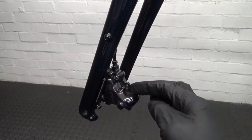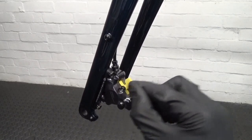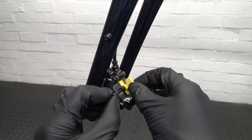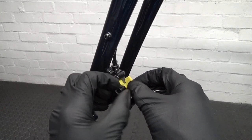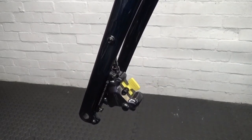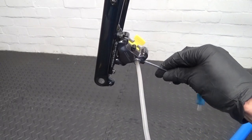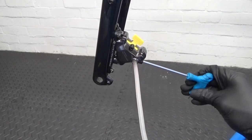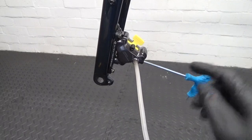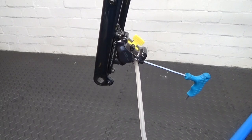Now you've got your bleed block you can use in the middle. You slide the bleed block in from the top like that on these, and then put your pin through the centre to hold your pads in — that's a 3mm hex on these now, it was a flat blade screwdriver before. So you've got the bleed hose attached here — just take the rubber bung out and put your hose in, and then the same on this side. Take the rubber bung out and you've got a 3mm hex in there to open and close the bleeder. If you want to know how I bleed it, I'll put a link up on screen — that'll show you the easiest way, literally takes no time at all. So if you watch that video then you'll see how I'm doing it, so I'll just bleed these up and then we'll get back to it.